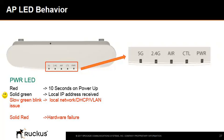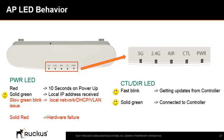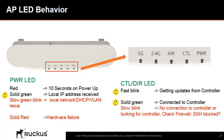If the power LED remains solid red, this indicates a hardware failure and the AP must be RMA'd for replacement. The CTL or DIR LED provides connection status between the AP and the SmartZone controller. Once the power LED turns solid green, the CTL or DIR LED will blink fast, indicating the AP is getting updates from the cloud controller. Once the connection is established, the CTL or DIR LED will turn solid green. If there is no internet connection, the LED will blink slowly — check for firewall issues, DNS resolution, or whether SSH or HTTPS protocols are blocked at your venue. Within 5 minutes, both the power and CTL or DIR LED should be solid green, meaning the AP is successfully communicating with the cloud server.